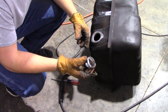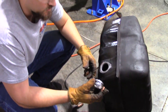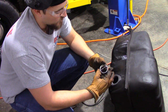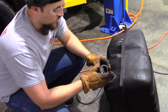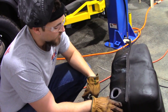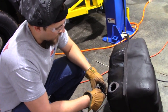Yesterday we aired out the tank, filled it down with water, and neutralized it. I got it neutralized enough so we can cut this filler neck off. Now what we're going to do is weld this nipple on the new tank. We'll put a hose over this and connect it with the filler neck using two hose clamps - one here and one on the filler neck, and we're done. Again, this is a new tank, it's never had any fuel in it, so I'm cool with welding on it. But if it was a used tank, I wouldn't even touch it. So we're going to get after it, weld this up, and rock and roll.